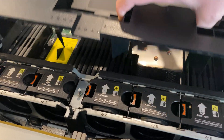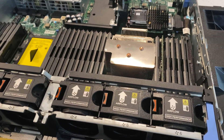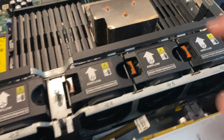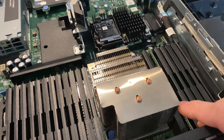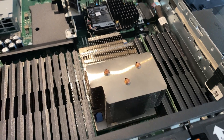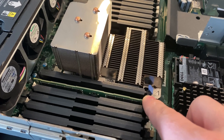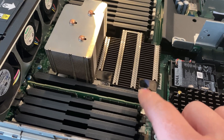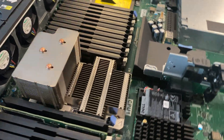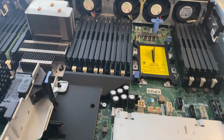Let's take out the shroud and you'll see why one CPU is missing — there's not really much need for dual CPUs in a storage server. This is a 6-core Intel Bronze 3104 at 1.70 GHz, more than plenty for storage needs. Running FreeNAS, which is now TrueNAS, I'll eventually upgrade the memory, probably up to 64 gigabytes, but as of right now it's more than enough for testing.